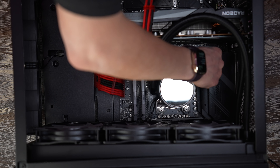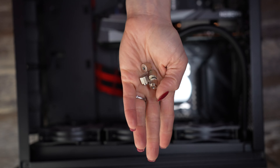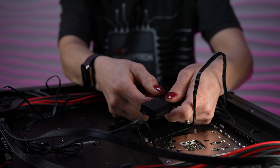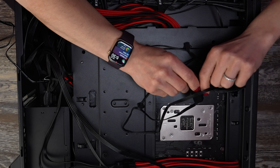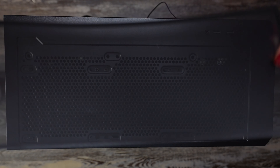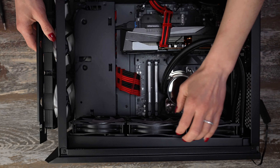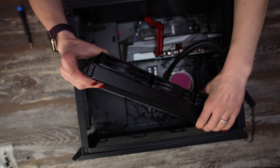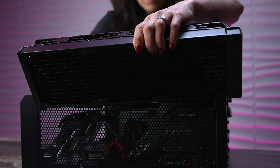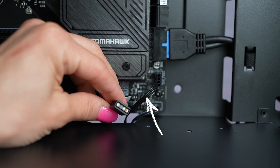Next, we're going to remove the pump. So we grab our Phillips head screwdriver and take off these four silver standoffs that are holding the brackets in place. Then we will disconnect all the cables connected to this AIO, which include four RGB cables that are connected to this ARGB hub, and three fan headers connected to this fan hub. Next, we're going to remove all 12 screws that are holding the radiator in place. This is when you're going to need to move the front fans just a little bit to give yourself enough room to get the radiator out. As you wiggle this out, don't forget to remove the pump header attached to the top of the motherboard.